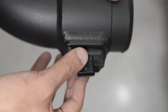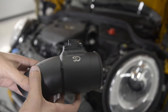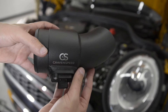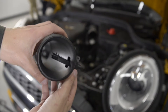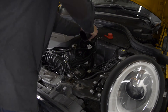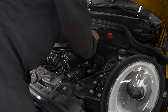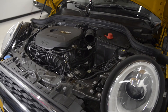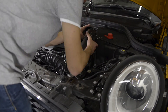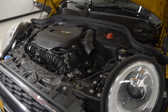So you remove the MAF from the stock air box and place it into the Craven Speed piece. It doesn't sit perfectly flush when you first put it in — this kind of had me worried — but once you put in the screws that hold it, it is perfectly flat. It's a perfect fit; it almost looks stock since the color is exactly the same, which is awesome. Big ups to Craven Speed. Now, one of the more difficult parts of the installation is actually getting the piping piece from Craven Speed onto the intake hose. This takes a little bit of elbow grease — you've got to have a lot of patience and take your time, being really careful not to screw anything up. But once you have that on, you are pretty much set to go.